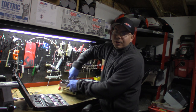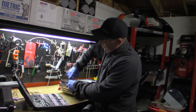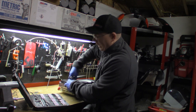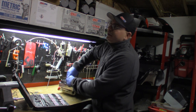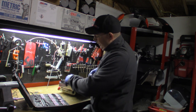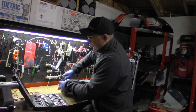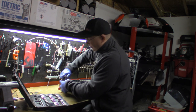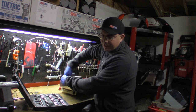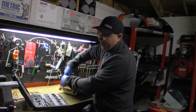If you're going to do what I did and tap that hole, you need to make sure that you get all the metal shavings out of the radiator. I don't know if the seller, of course it comes from China, I don't know if they actually had a radiator and they just looked up the part number from Polaris and thought it was the same as the Predator, but these Outlaw radiators are not the same as the Predator, so...